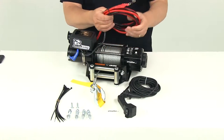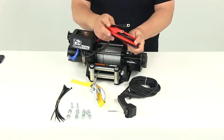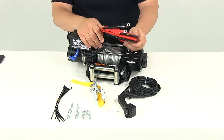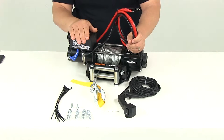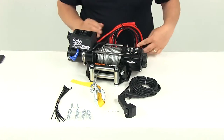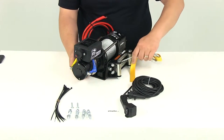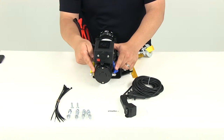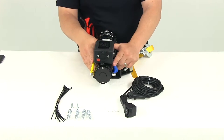The red and black wires are going to be your battery leads — these connect to your battery, and they've got terminals on the end. That's going to give you six-foot leads, so plenty of wiring to run and make the connections. Every connection on this unit is color-coded, which is one of the great features about this system. You're going to have the black and red battery leads, and then the connection from the winch battery to the motor is going to have a yellow connector and a blue connector — also color-coded on the terminals so you can get everything easily connected.